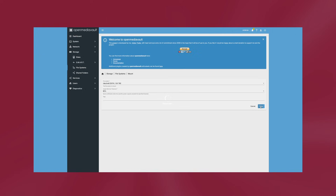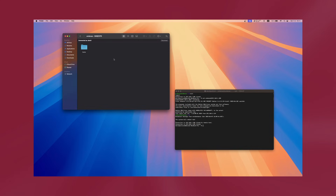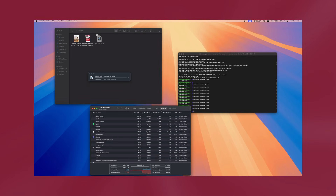There will always be a yellow pop-up telling you to save the configuration — always do so. Now you should be able to access your Raspberry Pi NAS on macOS in the network browser, or on Ubuntu using the SMB command. I tested the speed by transferring a single video file, and as expected, the largest bottleneck by far was the internet connection, so the speed was around 11 megabytes per second. Which is pretty solid for normal use, but when transferring large files it's a little bit of a hassle.